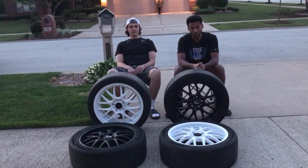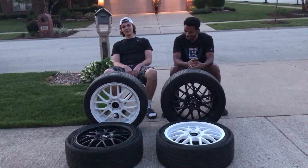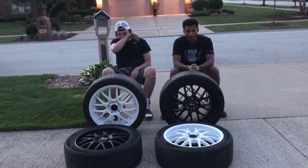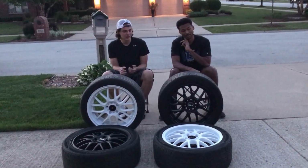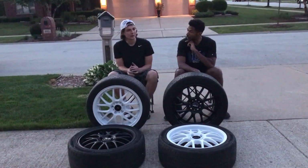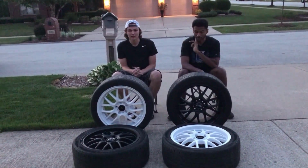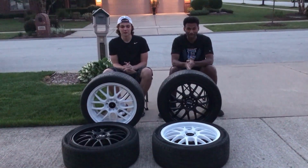Literally, we spent 40 to 45 minutes sanding this down to make sure you get the fine grit. I go 400 and then 1,000. So pretty much step by step, what we did was clean them with degreaser and Dawn soap. Then we left them wet to do a wet sand. Don't get it too wet, or else it's hard to sand. And don't sand it dry, or else you'll scratch them up.